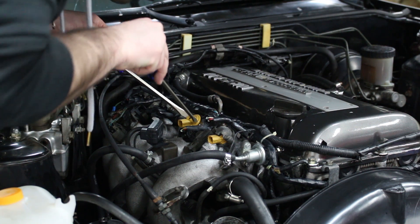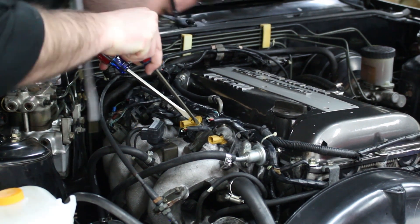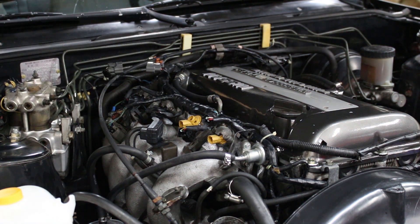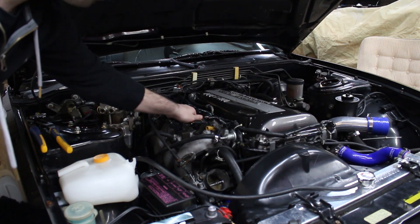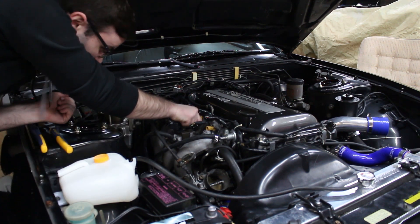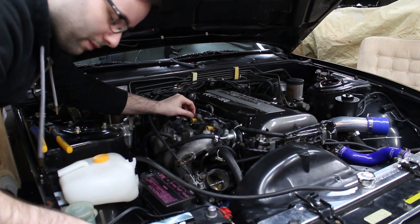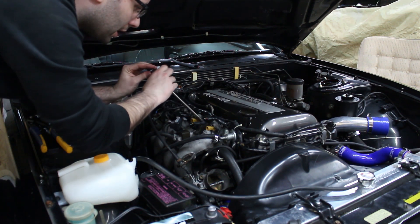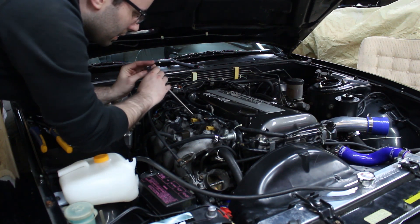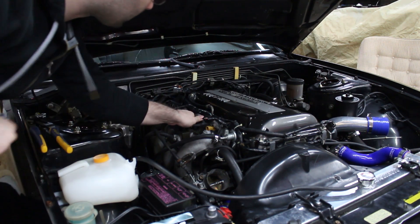I don't know what the forum thinks you do with these screwdrivers except maybe this. Oh, I got it! But I got that one on my own. It's like I'm 17 again doing car work. So you have your cap, and once the injector is in, you should be able to move this injector kind of like you did the previous one. Just put your screws in — that you lost or bought again from the nearest hardware store, or dug out of the washer where you found some socks you forgot you had, or dug around the floor of your garage — and tighten these up. These are aluminum, so you don't really want to tighten them up too terribly much. Then just repeat for the entirety of the fuel rail until you are done. Once you bottom out that lock washer, you're tightening up.